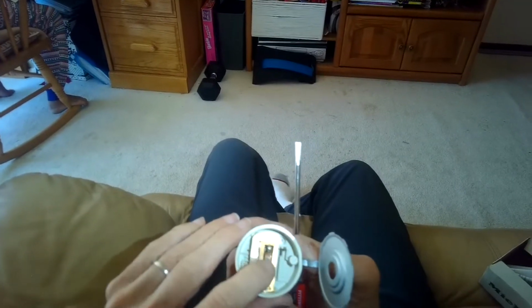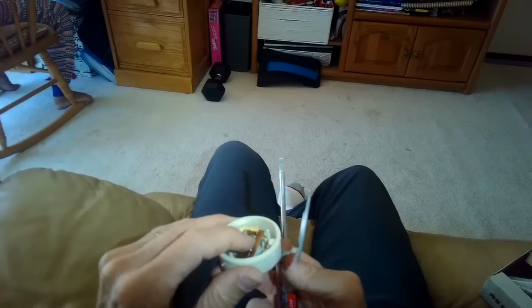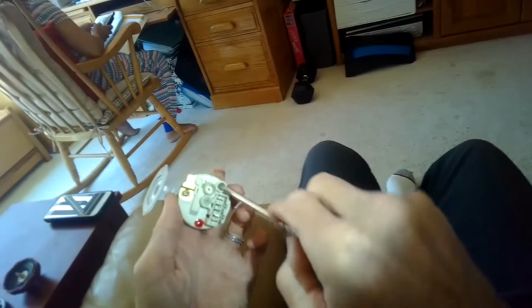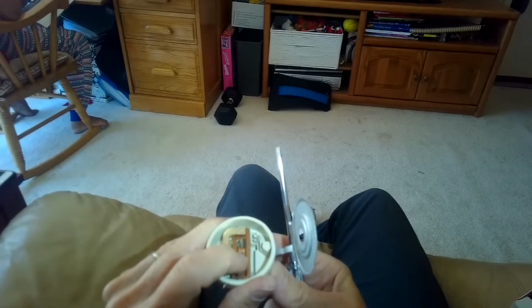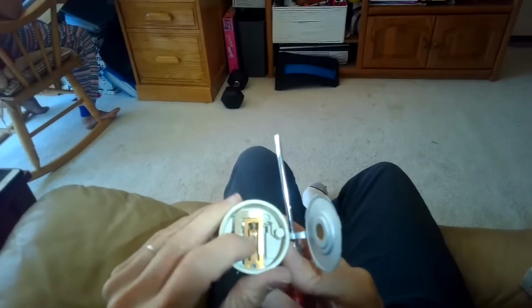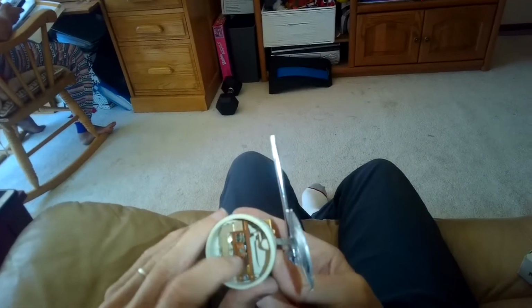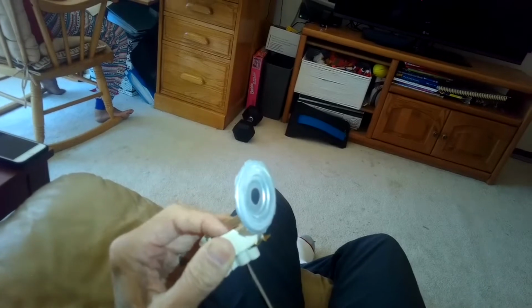So that's another thing you could consider if your dishwasher is just not creating enough pressure anymore for whatever reason. By turning this screw counterclockwise, it'll lower that plate, and then it should be more likely that its contact will close. Let's see what this screw does. I'll back it out now.